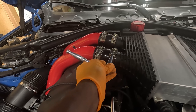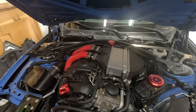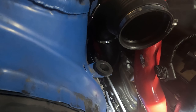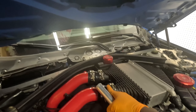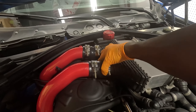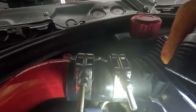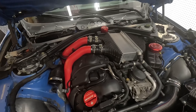Does anybody know the torque spec for these bolts? Leave a comment below. Alright guys, so these are all the places you want to check when looking for a boost leak — where the charge pipe is mounted to the turbo. Mine is secure, it didn't come off. So hopefully the oil residue that was on the charge pipe was my problem — these were a little loose, they didn't come off completely, just a little loose. So I'm just gonna go ahead and put everything back together and do a test drive.